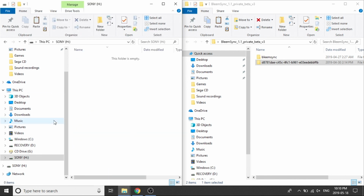One thing I want to mention with this installation: we're going to be going back and forth from the PlayStation Classic to the computer just a couple of times because there are going to be some file transfers we'll want to do. Essentially, this build is going to take a backup of the existing kernel information and the existing software on your PlayStation Classic. It's going to load that copy onto your USB drive, and then we want to make a copy of it and keep it somewhere safe. The reason is that in the event your PlayStation Classic gets corrupted or something happens to it, those recovery files are going to be incredibly important for you to be able to fix it.